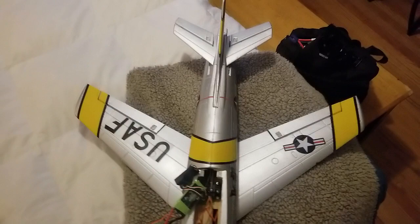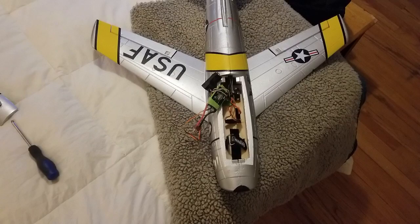I'm going to get this thing plugged in. I didn't screw these screws in all the way on the bottom because if I did and the fan's going backwards, I'd have to take these screws all the way back out again. The thing about these screws is they only mount into wood — there's wood underneath there that's glued onto the fuselage, and the more you take those screws in and out, the softer those holes get. If they get too soft, they could start getting loose while you're flying and you don't want that.